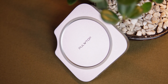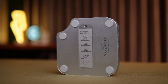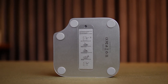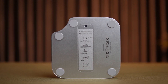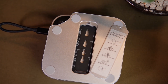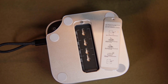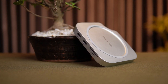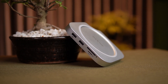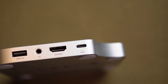One of the biggest highlights here is the built-in M.2 SSD expansion bay. You can add up to 4TB of PCIe NVMe SSD storage — that's massive for people working with large files like 4K video editors, music producers, or anyone managing big photo libraries. Just note this slot doesn't support SATA SSDs, so make sure to use a PCIe NVMe SSD in sizes 2242, 2260, or 2280. You'll also want to format the drive to exFAT if you plan on using it across macOS or Windows. What I love is that this adds storage without clutter — no extra external drives hanging off your Mac Mini. It's clean, efficient, and incredibly useful.